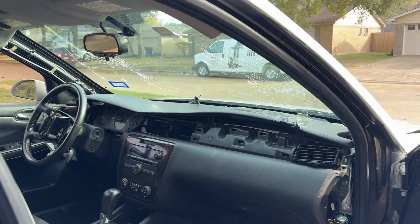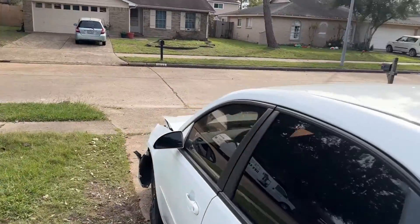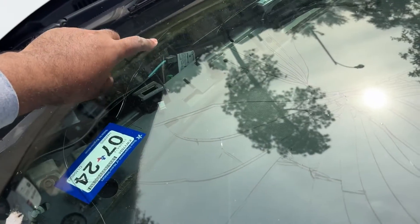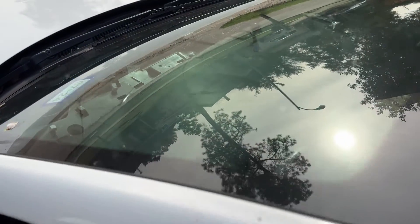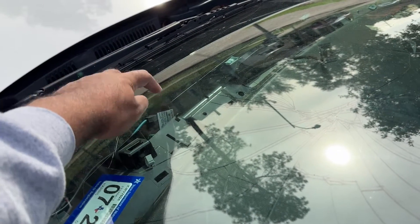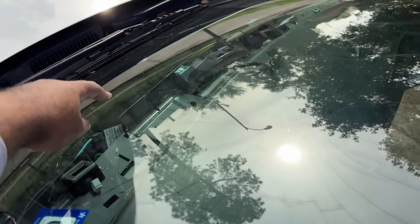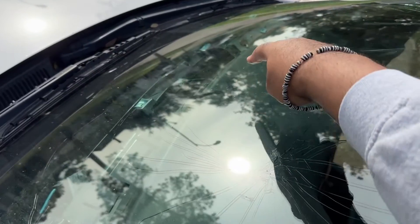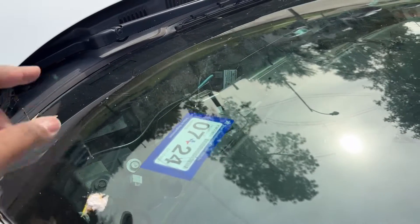There are also some wires — let me show you guys because I had this issue. Mine has this sort of — I don't know what that is, you guys let me know in the comments if you have this thing right here, because I tried to start the car without it and it wouldn't start. I disconnected it. You do have to keep this thing right here plugged in and it routes through that little slit. Then you can just rest it on top. There's also a little indicator light — I think for the security system.